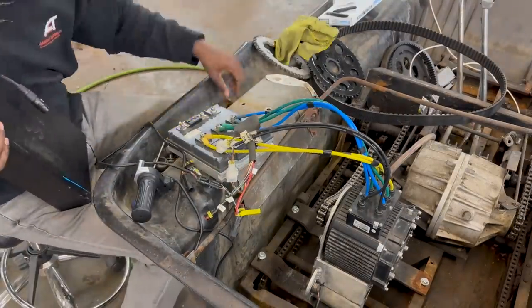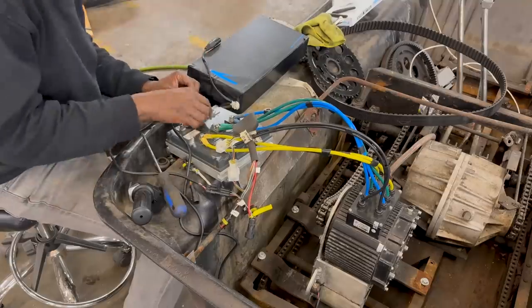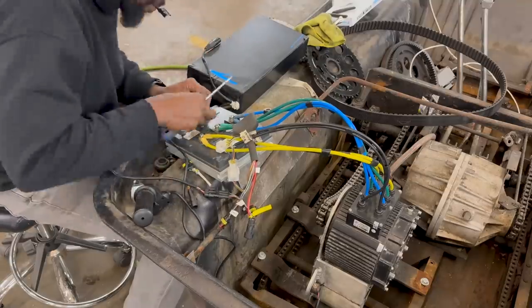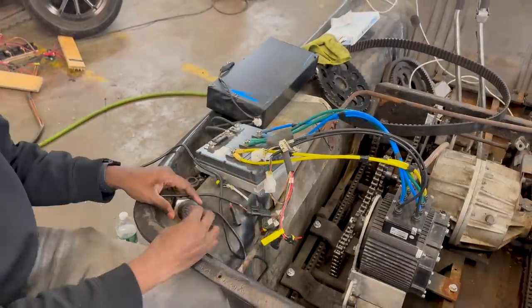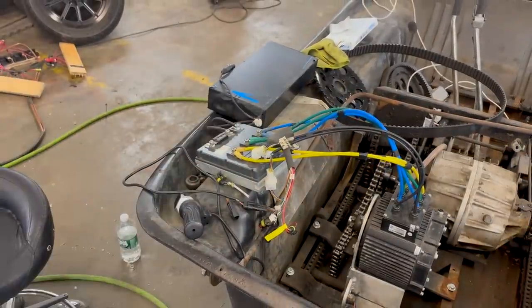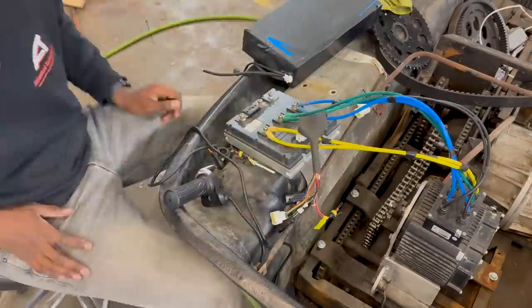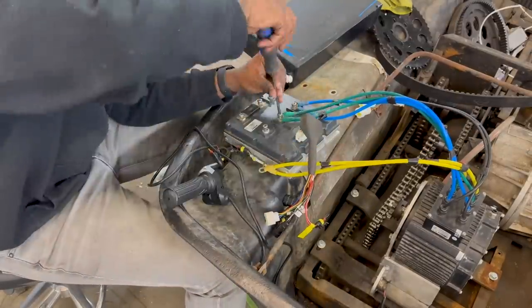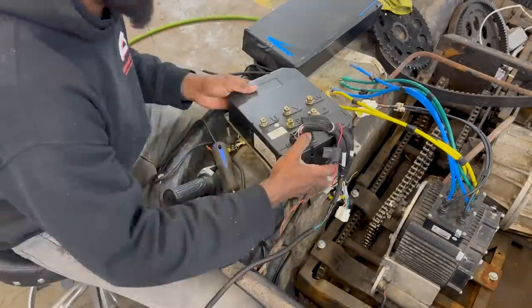So here comes the really hard part about troubleshooting things like this. Because this is mostly electronic, it makes it slightly easier to troubleshoot. You get warning lights on the controller that correspond to certain codes you can use to diagnose what's going on. Unfortunately, this controller that I use in the City EL isn't giving me any signs of life. There's no flashing error lights, there's really nothing when I hook it up directly to the battery.